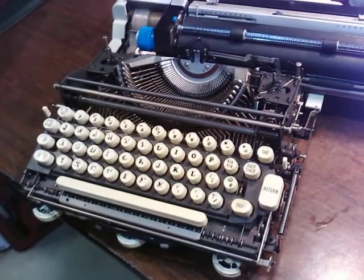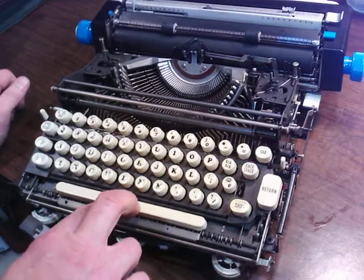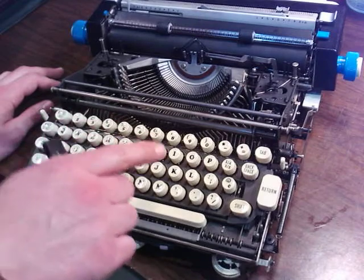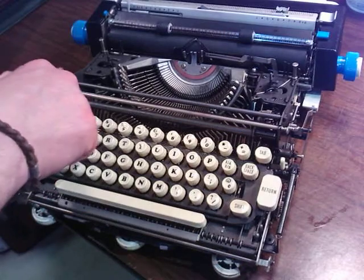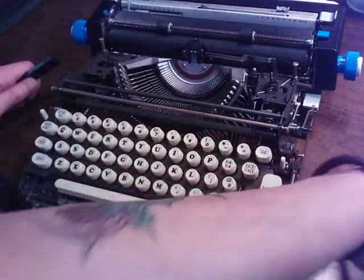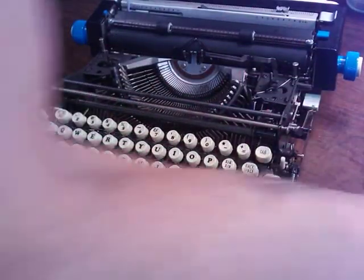So let's go over the features, which are, of course, minimal with nothing in it, but none of the keys would type. Huge problem with these. People believe it was a belt. No, it was, I'll cover that right away. So since it hadn't been used in a million years, I had to needle file out the green growth in the copper with my Ames file set.